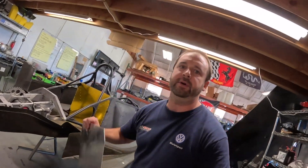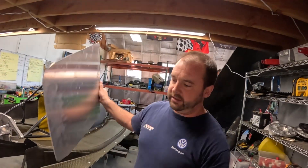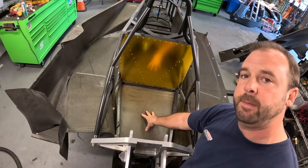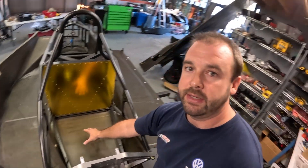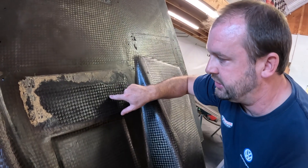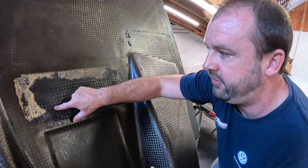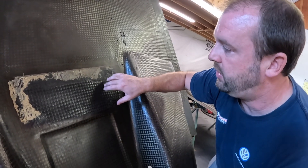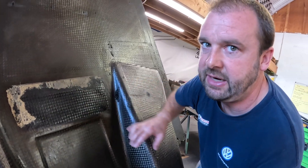Just to circle back as to why we ended up putting the titanium sheet in my car — as you can see, we did a pretty good job of beating up this floor. We've got some massive punches and holes and it's just altogether torn up. So that titanium sheet is going to do a good job of making sure that I'm extra protected just in case something decides to try to get through the carbon and into my body. The engine plate is going to be mounted to the frame and actually protect this carbon fiber right here, because as you can see, this is my old floor and it's actually just cooked all of the resin out of the carbon fiber, and that's dangerous because the actual resin is flammable.